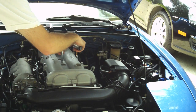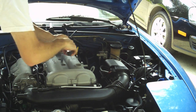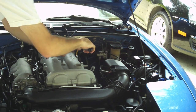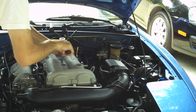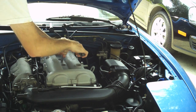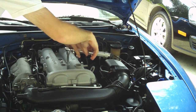Time to start tightening the bolts down. Now I've already put them back in place at this point. Set the torque wrench to between 43 and 78 inch-pounds. I set it for the high end because I want to make sure that the tension on the bolts is sufficient to prevent leaks. Tighten the torque wrench until you hear the final click. At that point you're good.